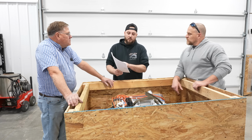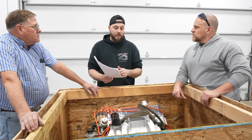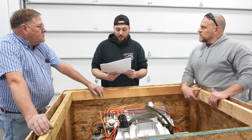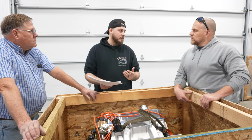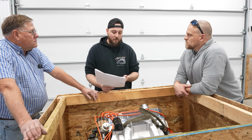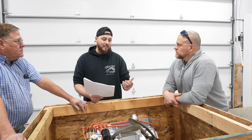Yeah. And what they'll do is compare to your previous samples with some context. I gave them the context that this only has dyno time on it. And they came back, all other results are within normal ranges. So resample it next oil change to monitor and establish a trend. Okay. So if it comes back and you still have numbers that are scary, and again, after the first 500 miles, there may still be some that are slightly elevated.